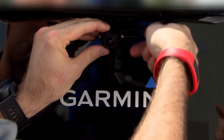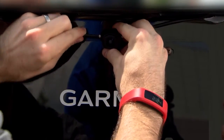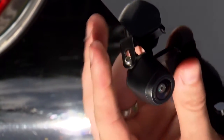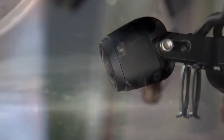Adjust the camera in the bracket using the included hex key on the two hex bolts. If you mounted the camera bracket to the bottom of the license plate, remember to rotate the camera 180 degrees before securing it to the bracket so the video feed appears right side up.